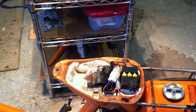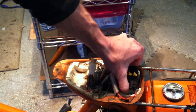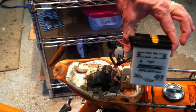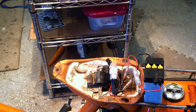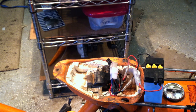This is a '77 or '78 Honda Express, so this should be the same for at least through '79, maybe '80. Here is the special tiny battery — part number 6N2-2A, a 6-volt battery for the Express. I don't have a hose on it and it's pretty much dead. You can replace it with those deer feeder batteries — you just have to take out some of the styrofoam molding inside the seat pan.